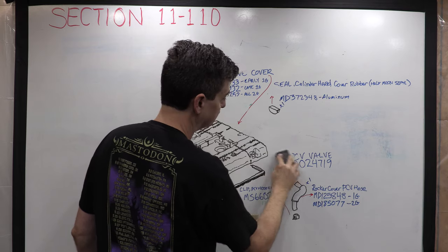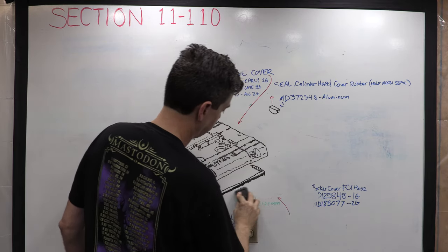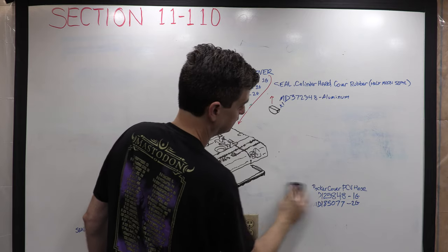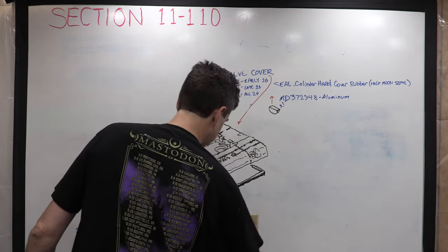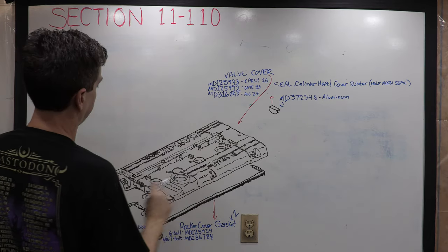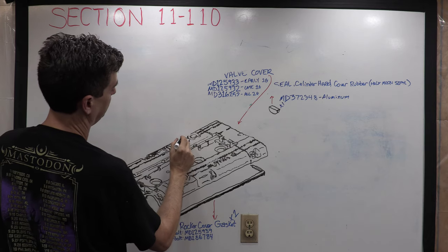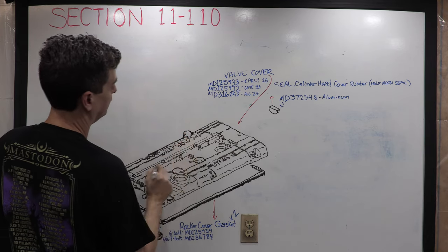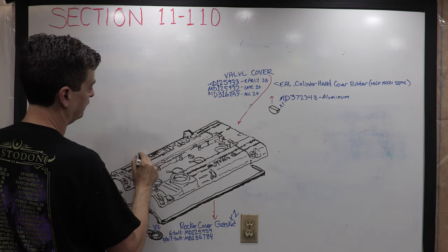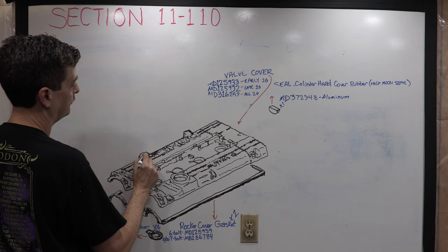My engine no longer has a working PCV system. The valve cover's blocked off with a quarter-inch NPT plug where the PCV valve used to be. So there's no valve, no clamp, no hose, and no connection to the intake manifold to pull vacuum. I'm using that port on the manifold for other things now. Those two ports were a little under a quarter-inch each. I'm putting three times the factory boost pressure through this engine than it was engineered for, so naturally it's going to make more blow-by.